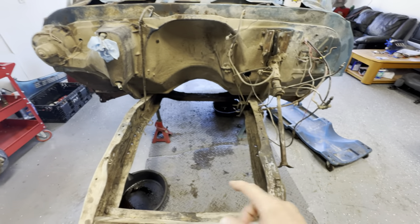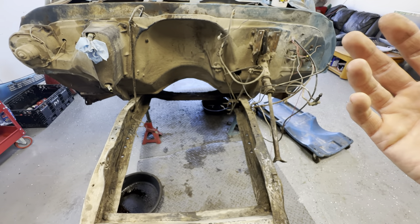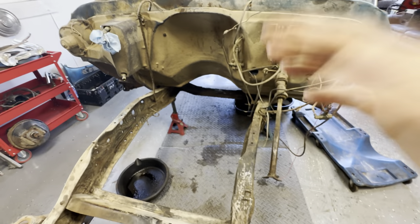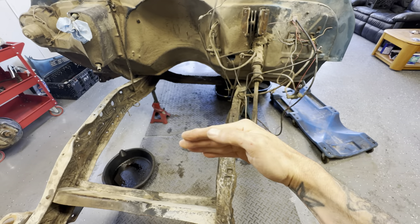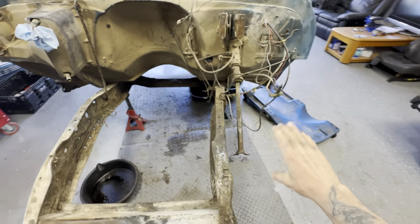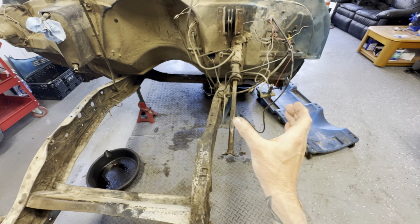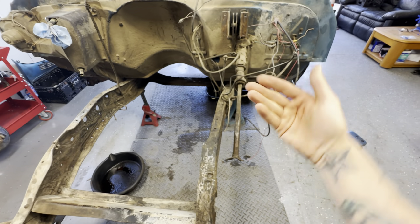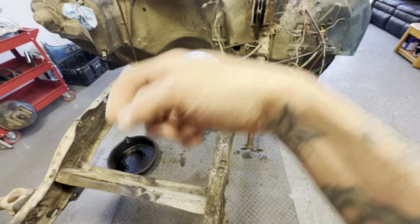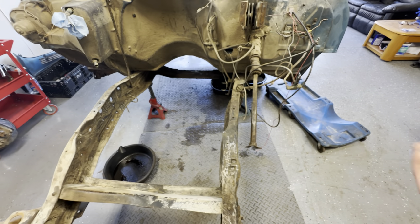But now I don't like that idea. The control arms are cast aluminum — back in the 80s people were on a lot of cocaine. If you know anything about aluminum, it has a life cycle. That's why a lot of these airplanes go convertible mode on takeoff or right before landing — the whole top just shears off or the door and the whole thing around the door — because it's constantly vibrating, like a suspension over these shitty Colorado roads. It's getting yanked, compressed, torqued — every type of load is getting put on those, and eventually they're gonna break.